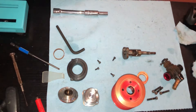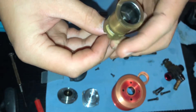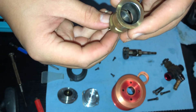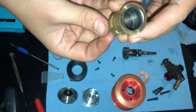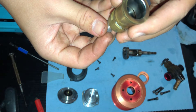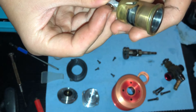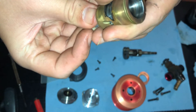This will be a little tight to start for break-in, but the main thing is that the pinch isn't starting too low. Right there is the exhaust port, and with a brand new OS engine, the pinch starts just above the exhaust port — about one or two millimeters above — and it's super tight all the way until top dead center. With this repinch, it's free the whole stroke and gets tight about two to two-and-a-half millimeters before top dead center. That's a good repinch right there.